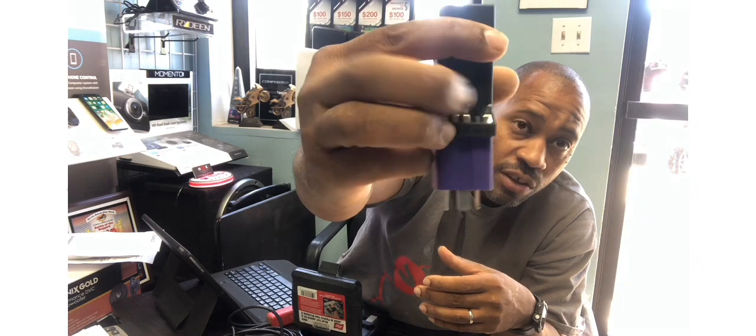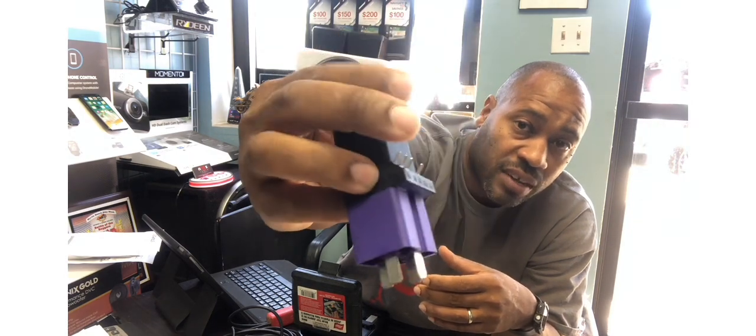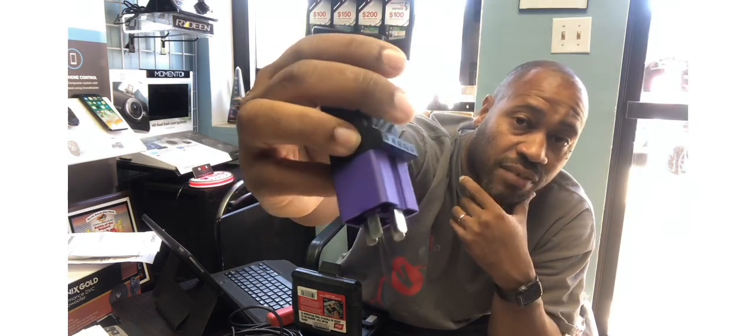So now you have your relay, your socket jumper, and you have all your leads available to do your testing. You can see if the relay is getting activated, you can see if the relay's got supply, you can see if the relay has output.